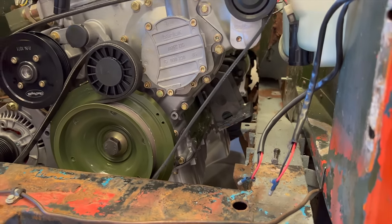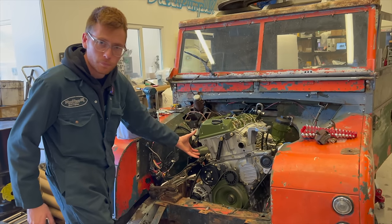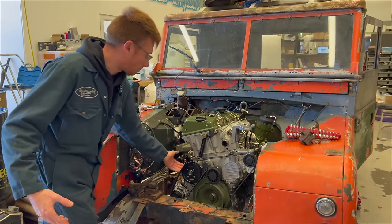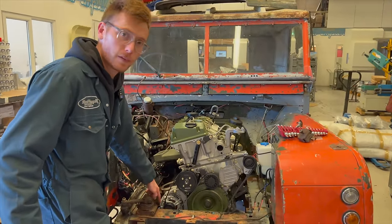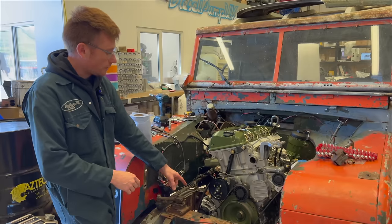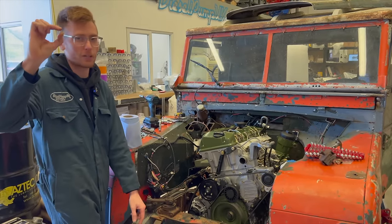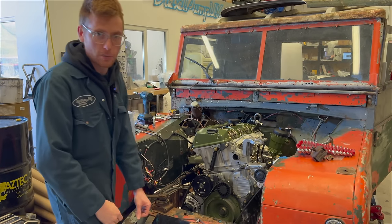We're making a bracket because our regular alternator bracket lifts the alternator up into a fantastic position with the regular turbos, but because we're putting a big turbo on we've actually designed a bracket that lifts the alternator 60mm and gets it away from the diff a little bit. With worn bump stops on this vehicle chassis the diff could contact the underneath of the alternator — we're talking like 10mm — so it's probably better to move the alternator up.